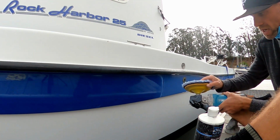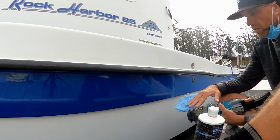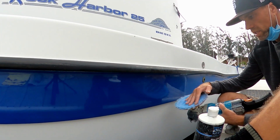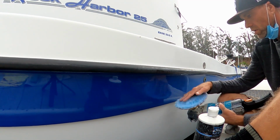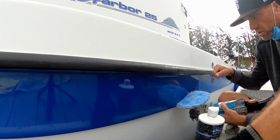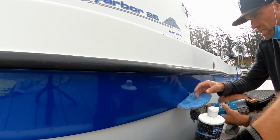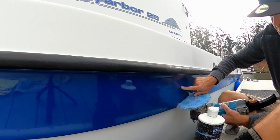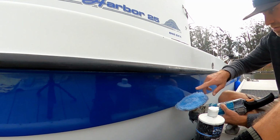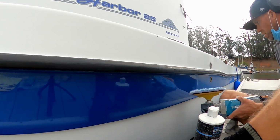So, 6-inch backing plate. I like these Lake Country foam wool pads. I did a review on these. You'll find it on my channel. I'll probably link it at the end of this video. Because I like them. They have good cut, and they're not super grabby. They're kind of grabby, but they seem to finish down. I mean, this is finished with just the compound, so these leave a really good finish. This would be perfectly acceptable for me.